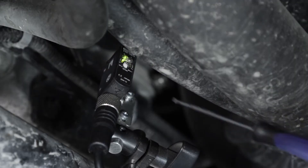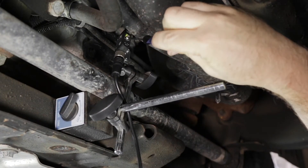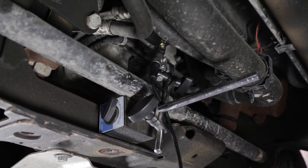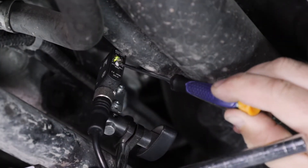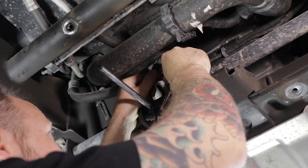Choose digital RPM input and set the degrees of plug fire to 360 in the RPM configuration menu. The green LED on the sensor shows that it's receiving power, and when the sensor is properly positioned and sees the reflection from the tape, the red LED will illuminate as well. If the red LED isn't lit, adjust the sensitivity of the sensor until both LEDs are lit. If the red LED still isn't on, try repositioning the sensor closer to the tape.